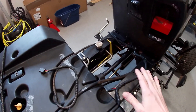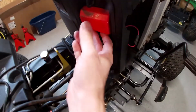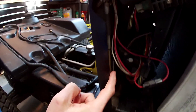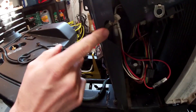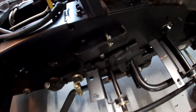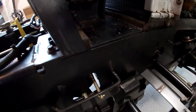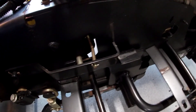With the platform off and everything cleaned up, I can see how some of the stuff works underneath. First, how does the park brake work? It's actually really simple. There's a lever and a shaft that runs down behind the dash in two sections joined with a spring coupler. All it does is move this lever up and down, so when you push in the brake you lock the service brake down — the service brake and the park brake are really the same thing.